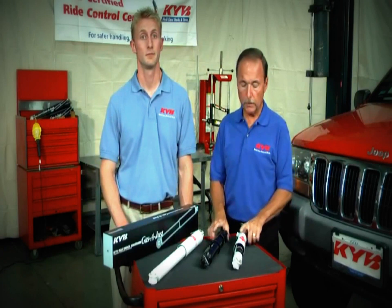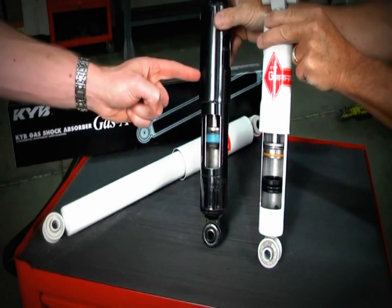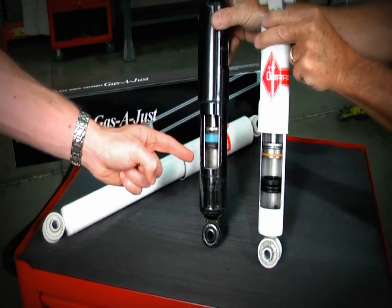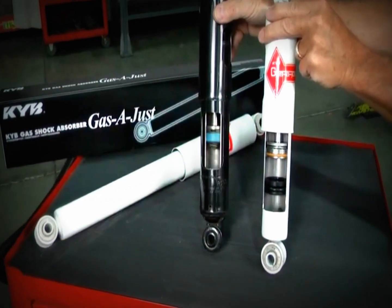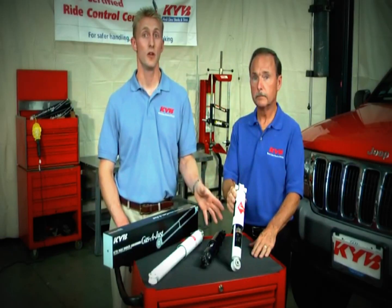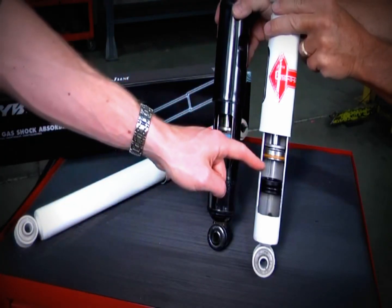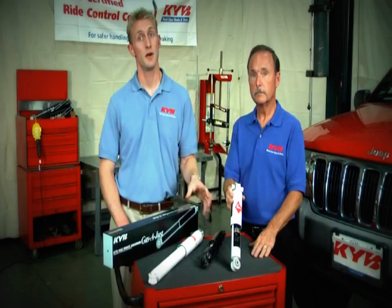The Gas Adjust is also available as a performance upgrade for vehicles that came equipped with standard twin tube shocks. Here are two very different cut-away examples to show you the difference. Both have a shaft, moving piston, and hydraulic valving. This one is a typical twin tube shock. It uses a smaller working cylinder, and during operation fluid is moved in and out of an outer fluid reservoir. That works pretty well, but the design isn't as efficient when you need or want more performance. As you can see, the KYB Gas Adjust monotube has a larger, single working cylinder. The main benefit is that the hydraulic fluid doesn't have to travel as far.